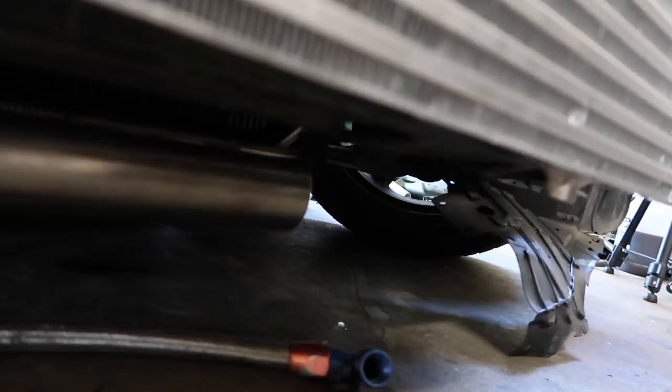It just goes right underneath the other part that I ran over on the crossover. I'm still waiting on the boost actuated cutout, so that's probably going to go over there next. Then it will transition from 3 inch to 2.5 after the cutout, so when he's under boost, he doesn't have a restrictive exhaust on it, and it will still make a good amount of power. And he's going to be taking it back over to wherever he's from.